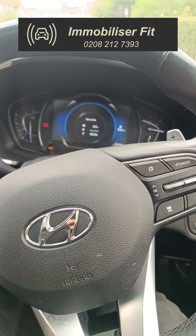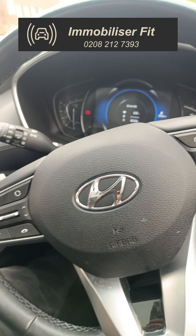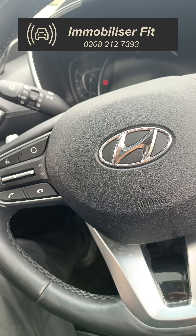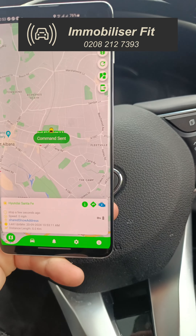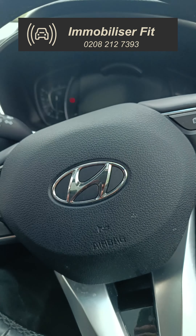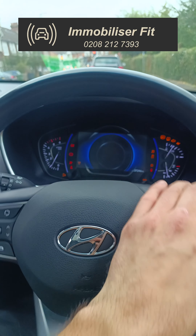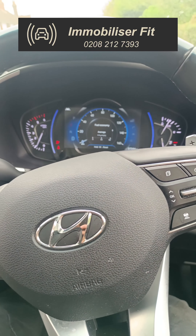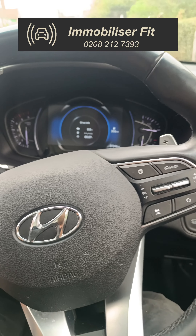It's done a total kill — the vehicle is going nowhere. The only way for it to accept the code again is to go back into your app, click on the correct vehicle, and turn immobilisation off. Only now will it accept the code, so we start the car, enter one two three four, get our flash, and we can now drive it home — the vehicle is saved.